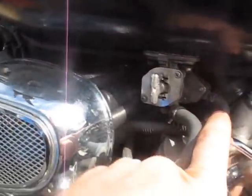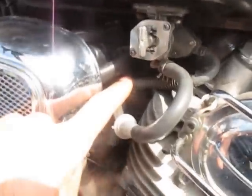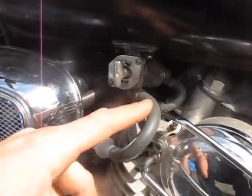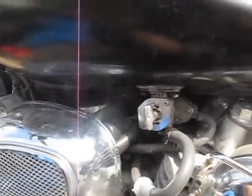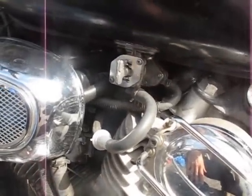What I've got to do is fix this. This is a vacuum actuated petcock, which means that vacuum comes from this little hose right here, opens this valve, and lets the fuel in. In theory, it's only supposed to do that when a vacuum is being supplied by the engine — gas is only flowing when the engine is running, except if it's in prime. But right now it's in on, and it's still flowing, and that's where the problem comes from. It should be closed. What you could do is buy a petcock rebuild kit, but this video is going to be about how to restore your petcock without buying a rebuild kit.